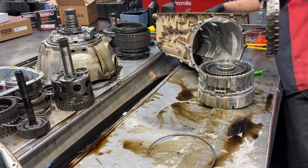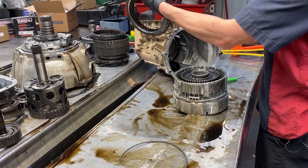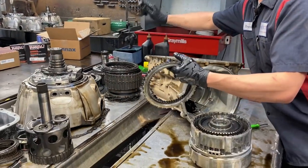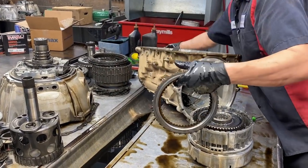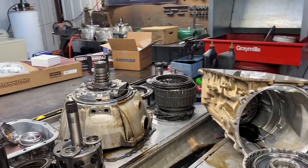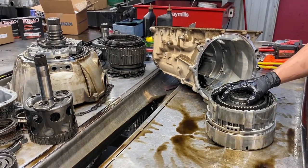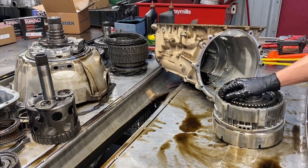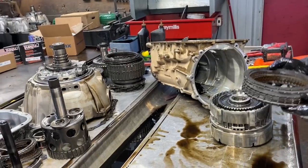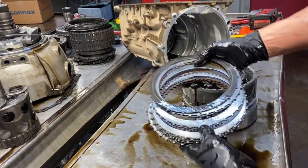The two-six wave spring was broken on that other transmission - another failure point. This is a 6L80 right here. They started making these six-speeds back in around 2008, 2009. If one comes in, we'll see another one - we're going to start seeing more of them.